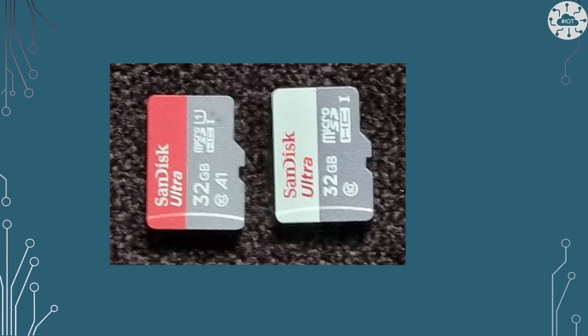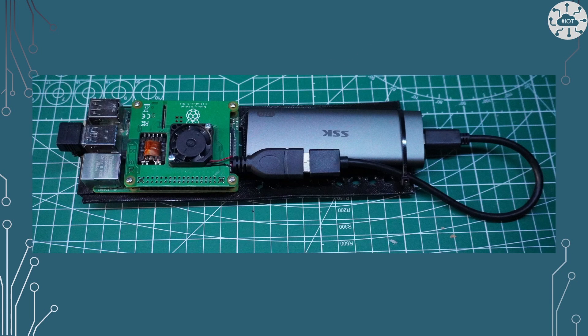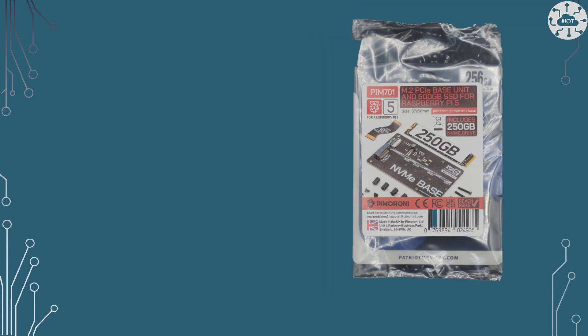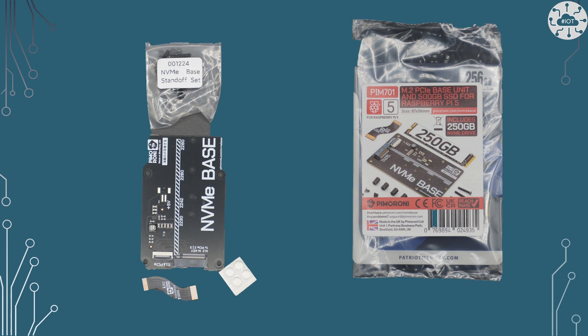I run very few of my Raspberry Pis on micro SD cards — perhaps just for the boot and setup. Those that operate all the time are nearly always on an SSD. For a Raspberry Pi 4 those have had to be connected via USB, which is a little bit on the clunky side. But for the Pi 5 I can put an NVMe drive via the PCIe bus, and that's what I did. So I bought a Pimoroni NVMe base unit with the SSD kit. This comes with a base PCB, standoff screws, ribbon cable and feet. I won't show you how to install it — Pimoroni have got much better video on YouTube, so I'll put a link to that in the description.